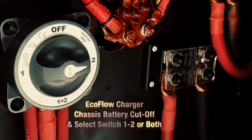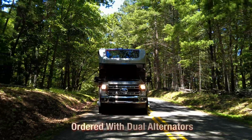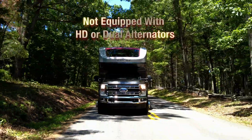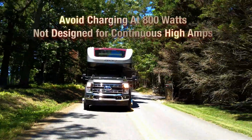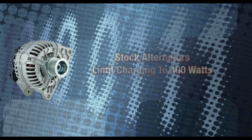Since all my RVs will eventually be upgraded to lithium, I always order dual alternators to support lithium charging. If your RV, van, or car is not equipped with a heavy-duty alternator or dual alternators, avoid charging at 800 watts since standard alternators are not designed for continuous high output. High 800-watt charging combined with vehicle loads will result in heat-related damage to the windings coatings as well as heat-related bearing failures. For stock alternators, limit charging to 400 watts or less, which is more in line to Victron's DC to DC charger.